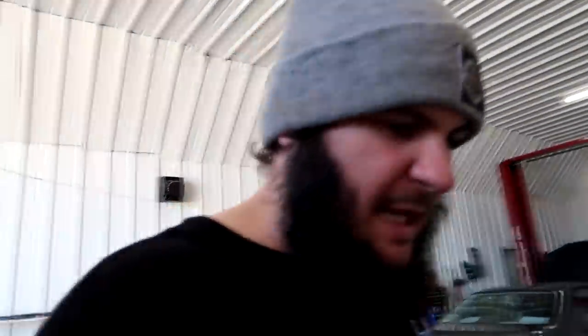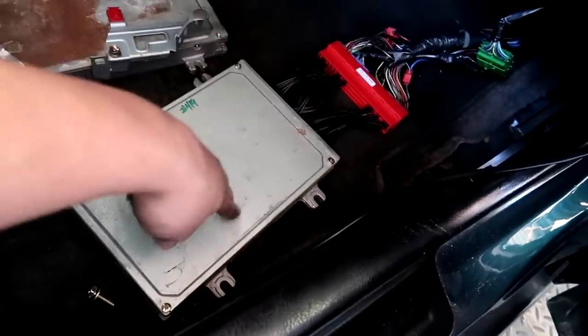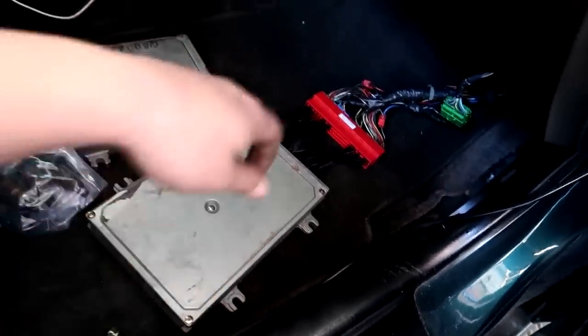I did end up chipping a P28 for him and installing a jumper harness. This car was running an OBD-2A P72 computer before it was turbocharged. He supplied the jumper harness; I supplied the ECU chipping, tuning, and installed the injectors. I have a base map in it for these RC550s — it runs pretty good, but it was a single-cam map to start, so we're going to have to add fuel into this tune to make it a closer base map.